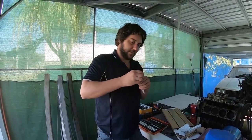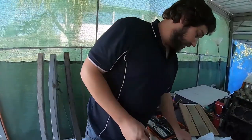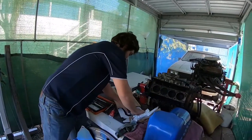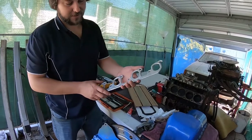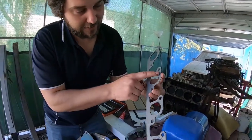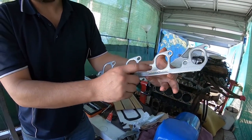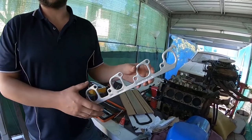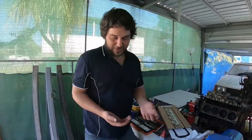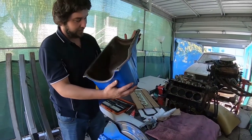A few times when I was young and putting some of my first builds together, I had an issue fitting these. They blow out — see how they're punched and wrinkled? These will only ever be sealed with the manifold, that's why it says manifold on it. It took me a little while to learn that you need proper header gaskets. You'll always learn a tip watching videos. Now be careful — we're about to bolt this back on, make sure it's clean.